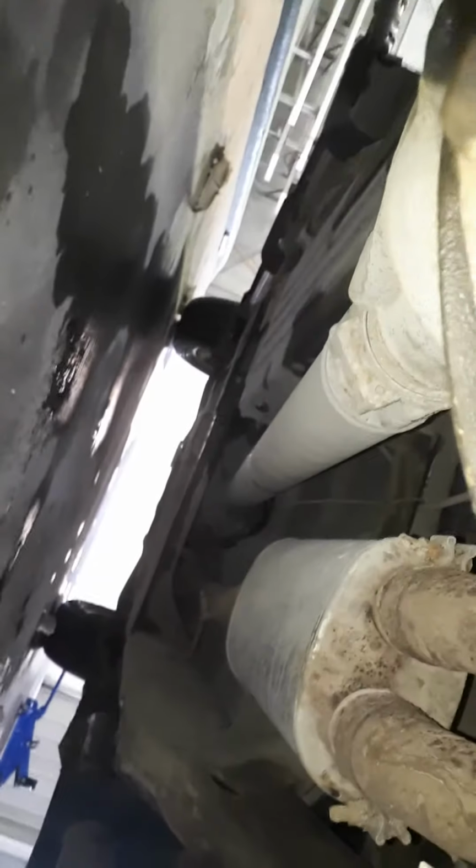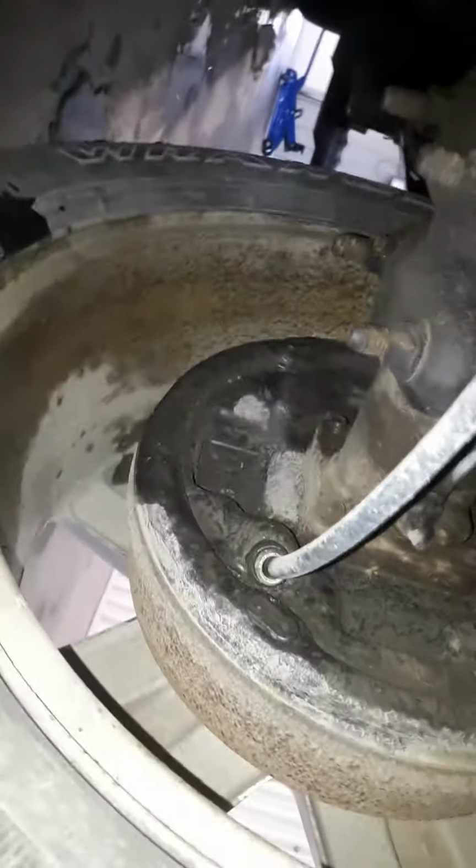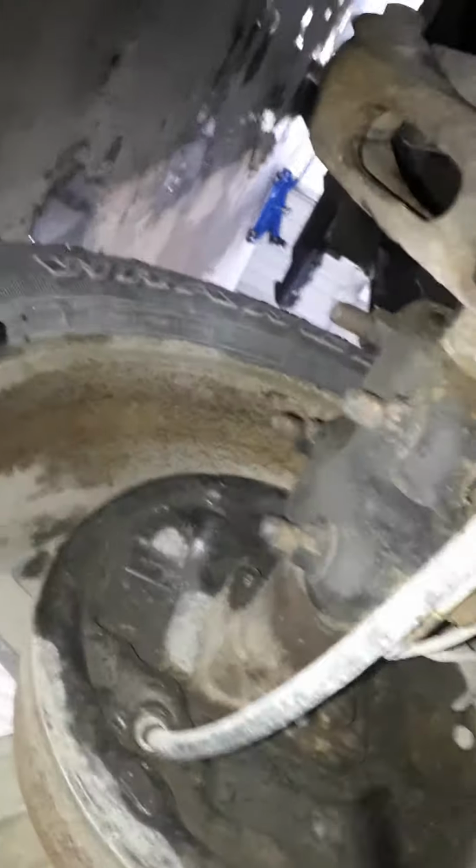Okay, on your right rear tread, about 30 to 40% there. Your spring is intact. No cracks that I can see. Your shock, you can see it's good and dry. Okay, another shot of the diff. No visible leaks. If you can see down, that's the muffler that's been modified. That's not the original. Okay, so no visible oil leaks, no issues with brake leaks that I can see, or differential, or any seal leaks at the back here. So that's the rear right.